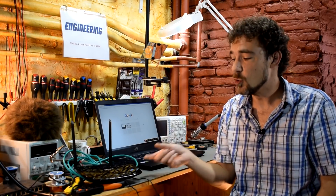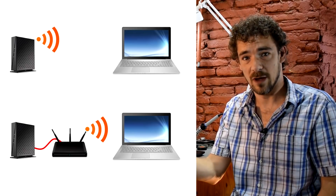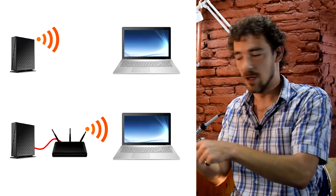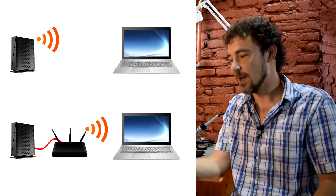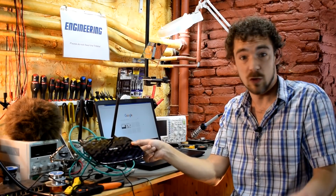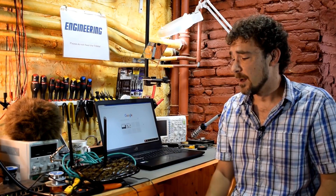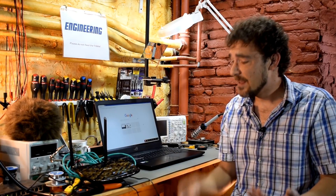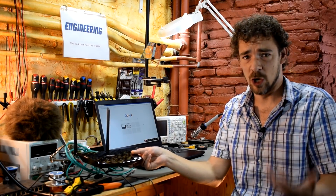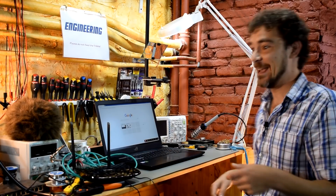In that case, what you can do is use an ethernet cable and buy a cheap Wi-Fi box like this one, turn the Wi-Fi on your ISP box off, connect one of these up with an ethernet cable, and then you'll be able to log in with your computer and lower the transmit power on this one. You simply won't use the Wi-Fi on your ISP-provided box. But in any case, if you have a Wi-Fi router like this, I'm going to show you the general way you can go and configure it. Let's take a peek.